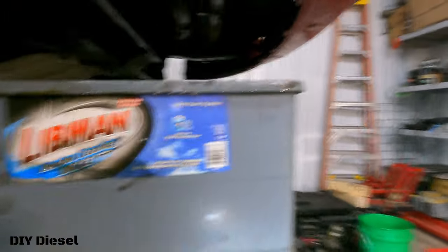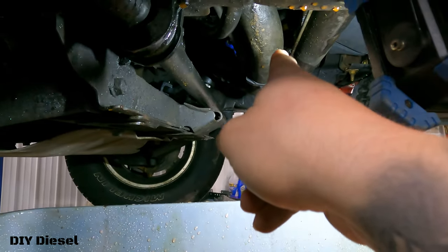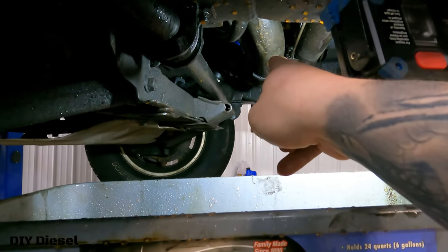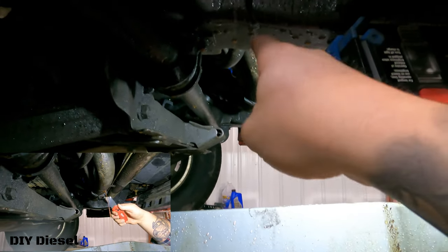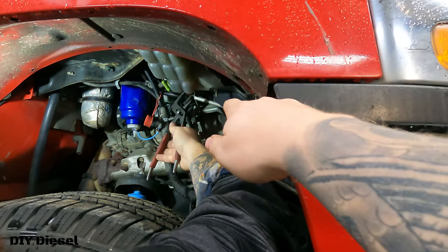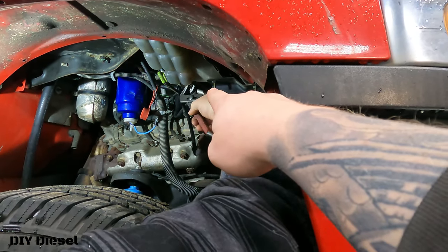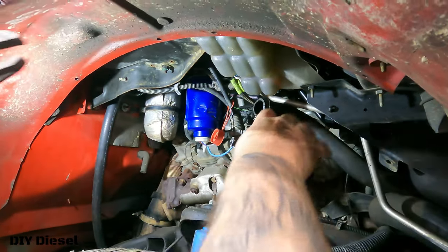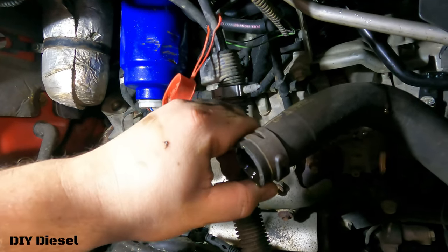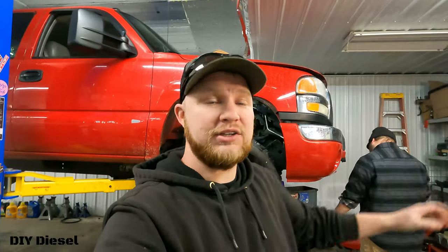We're going to do something a little differently here — we're actually going to cut the bottom of this hose. We've drained pretty much everything, but the lowest point is the bottom of the hose, which is still filled with coolant. So we'll just cut it since we're replacing it anyway. Next, we pull the hose off the very bottom of the reservoir. The clips can't spin since they're held on, so we'll have to break those off and reuse the clamps when we put the new hose in.